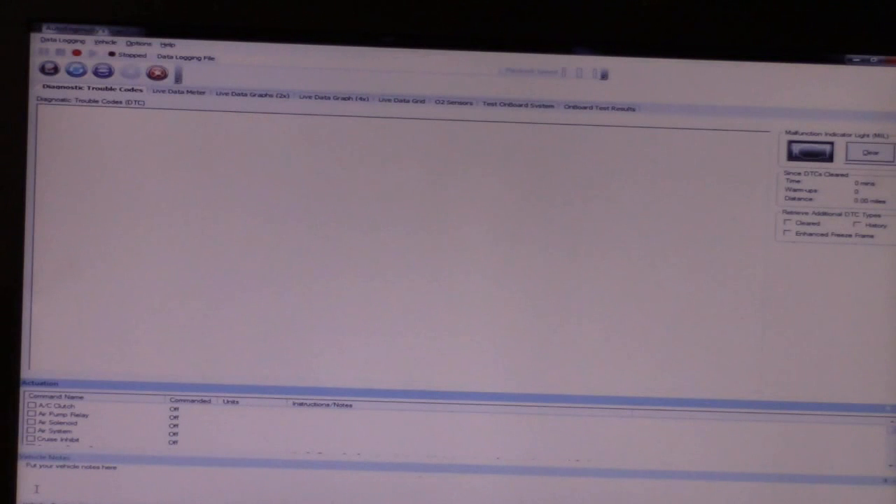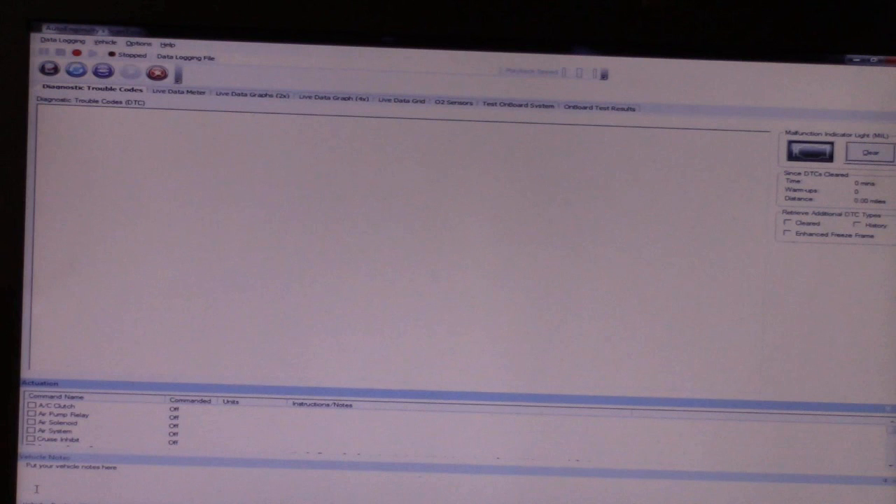I'm just going to turn the air pump on and listen for it. You heard the solenoid click, and the air pump runs. Then turning it off — in about a second right there I essentially did almost the entire video's worth of testing. It still doesn't check the check valves, the vacuum to the solenoid, or the vacuum line from the engine to the solenoid, so it doesn't really do all of that.